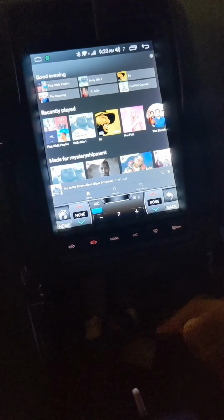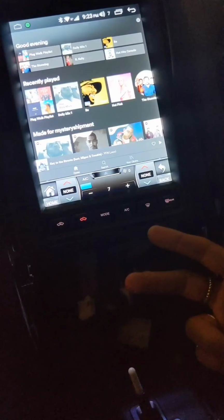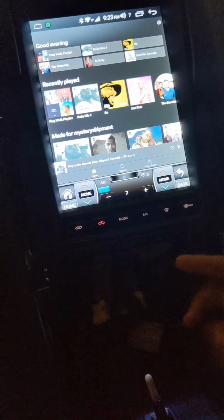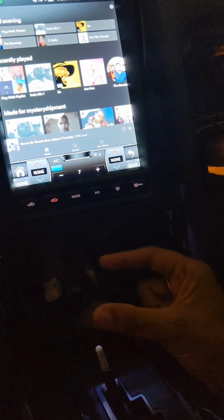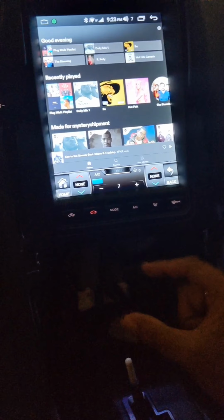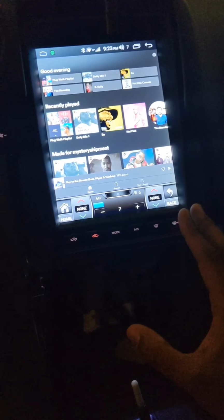Fan control. So this is the point of the install where the instructions say test your GPS, your 4G, and your climate control, your audio control. Now, I don't know if the camera picks up, there's a bit of white noise playing out of my speakers. It needs a bandpass filter installed. T-Rex support can guide you through that. They have their own set of instructions for that. But I'm just going to go through the pro panel installation.